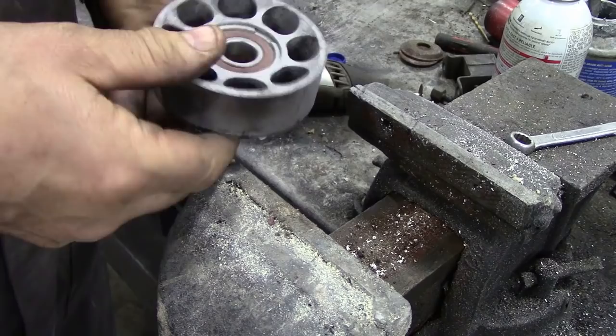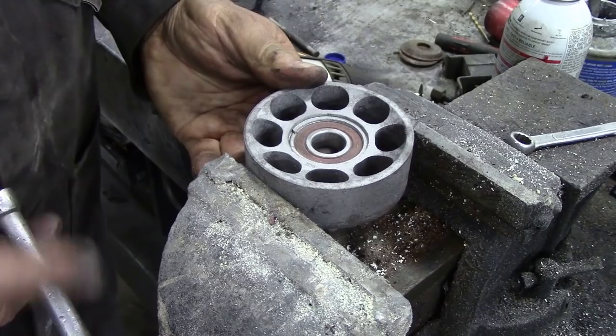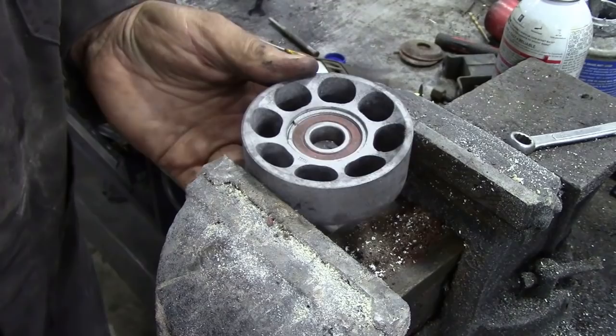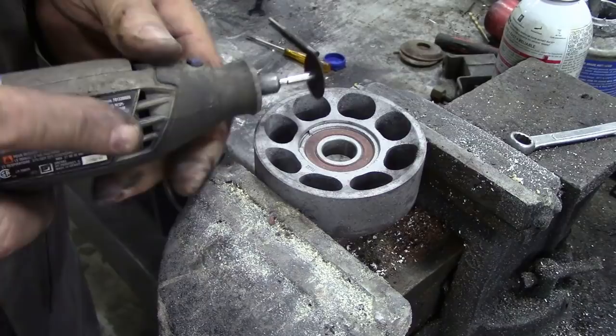On this V8, this bearing is really bad. I've just put it through the sand blaster and now it's all blocked up with sand. No worries, because I'm going to change the bearing. This is the same sort of pulley that's on the 300 TDI as well. I'll show you a quick way to do it. If we look at the circlip on here, it isn't a real circlip — it's got two little tapers, and you have a hard time trying to flick anything in there. What I do, because it doesn't cause any damage, is use a Dremel and put two little cuts in here.